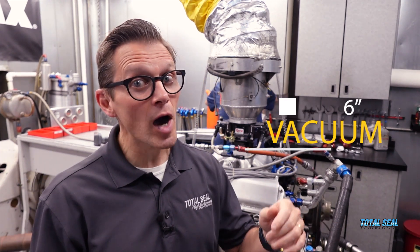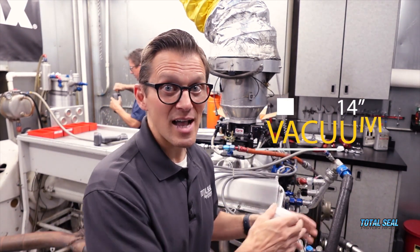So we've re-baselined the engine with the old carb and the standard NASCAR fuel, and the thing's making about 765 horsepower — up about 15 horsepower from where it was previously. With the oil pump, it's the old oil pump but the guys at Line-to-Line coated all the gear sections, so we've gone from about 6 inches of vacuum to 14 inches of vacuum. The baseline's there.